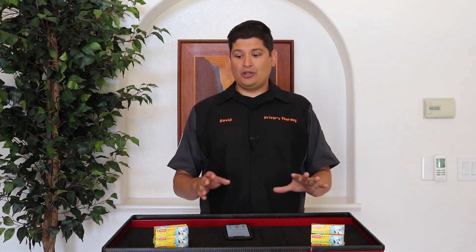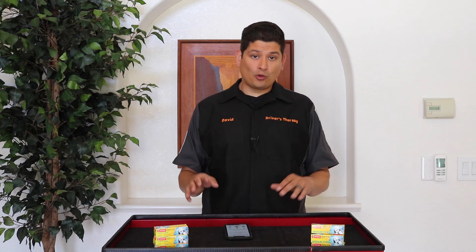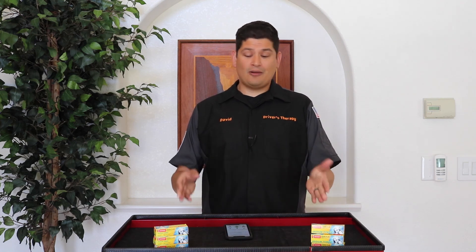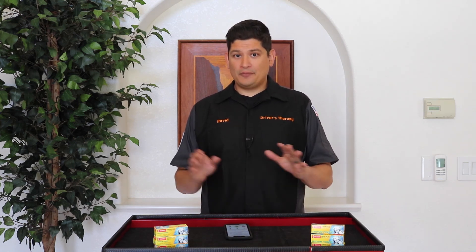If you guys are running BPU, I highly recommend looking at a colder plug. You don't have to use this brand, but just in general I think it's one of those good rules of thumb. I know engine builders and experienced tuners know this, but I didn't know it, and I thought I'd make a video to share it. Maybe you're running BPU and you've never thought about getting a colder plug — it's a great thing.